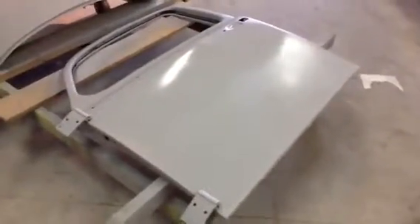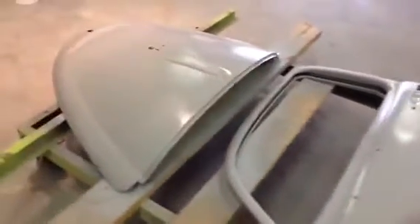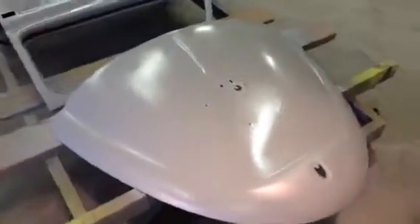I've been cutting my teeth as usual on the whole process. I've been using guide coat — that's something new. Guide coat is a spray you use over your Bondo, your skim coat, or your sandable primer, which shows the high and low spots. You sand until it's gone and it kind of reveals where you have to re-prime or put new filler, new Bondo. I have been doing some tight pulls of Bondo — less than a millimeter thickness by the time you sand it all back off again. These are looking pretty good.